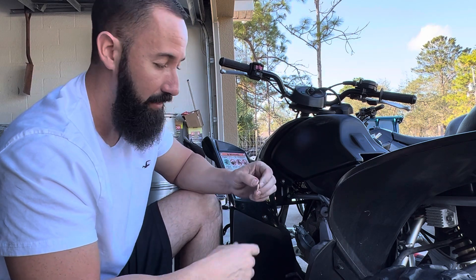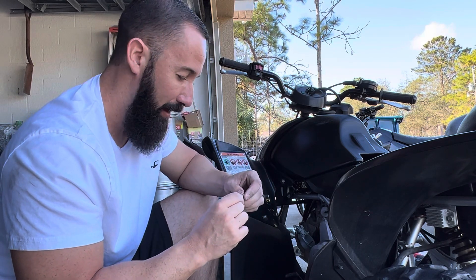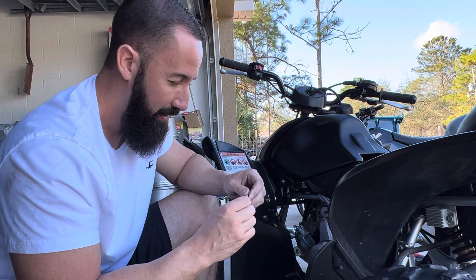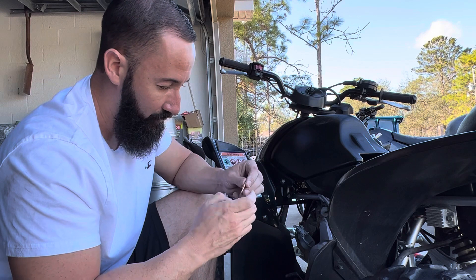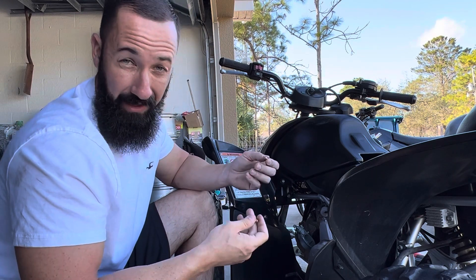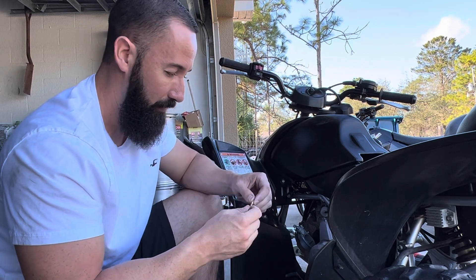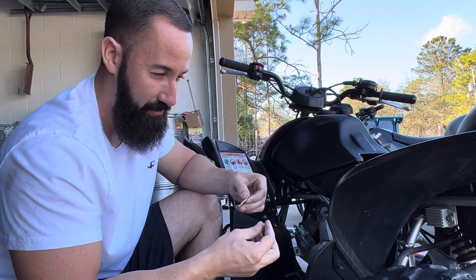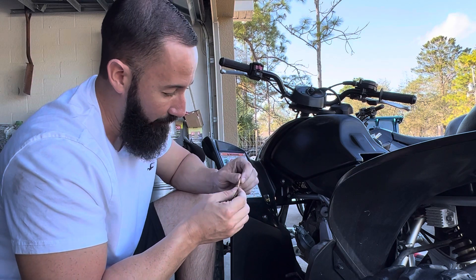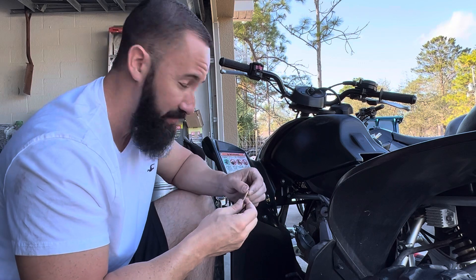I should have one of these. If not, you can get one from a local motorcycle shop - they're pretty common. I would suggest pulling your carburetor apart and bringing it to the shop so you can compare it and get the right one. There have been plenty of times where I've gone and gotten a pilot jet and main jet, and then similar to this situation you pull it apart and the jets are either different or somebody has already been in there messing around, and you're kind of playing a guessing game. It's almost a better idea to pull the carb apart, pull the jets out, bring them to a motorcycle shop and say 'this is what I need.' Let me see if I have a 42 pilot and we'll get these put back in and see how it runs.